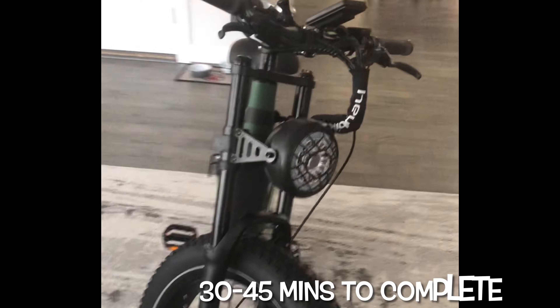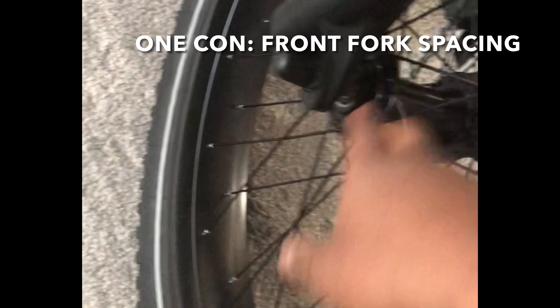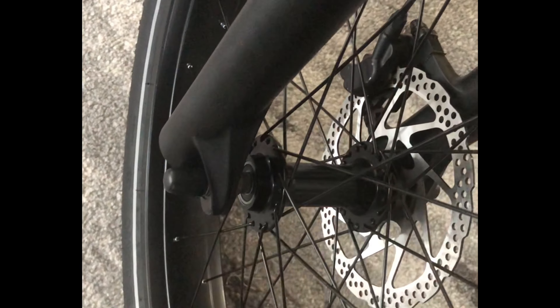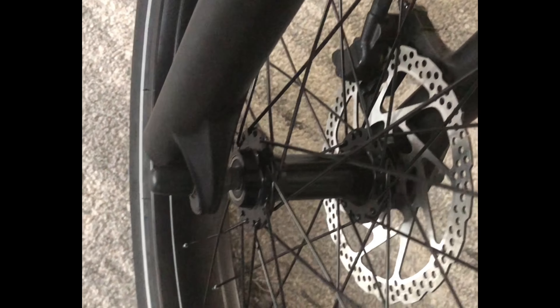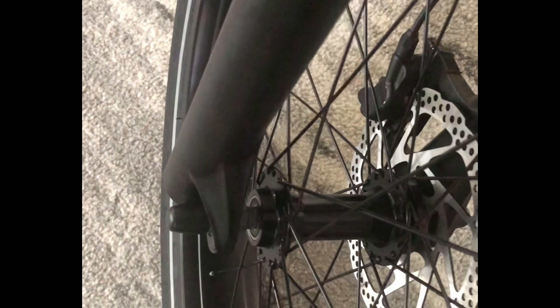I got the bike done. Here is the final look. I would definitely say look at the tutorials that are online — the instruction book, you can just trash that. It's not a good resource for knowing how to build this. I did have one area that seemed to be troublesome, but I figured it out. The bolt that they put in there originally — when they ship it, it gets kind of pushed in, and that creates a situation where when you try to put the tire on, things won't line up 100%. You have to actually pull it out just a little bit in order to get it to sit properly.